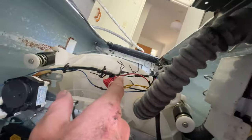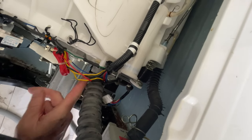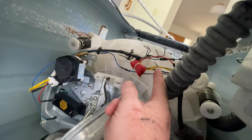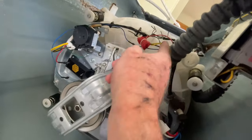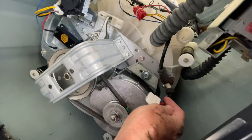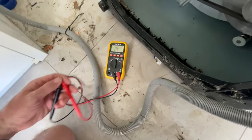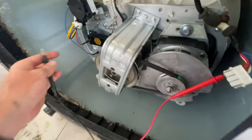A lot of the wiring — the green wire was actually very badly corroded inside. Before I joined it, I did have to clean the wiring. The red wasn't too bad. The blue wasn't broken up here — the blue was broken further down over here. The blue had a break in it. Now, to check the wiring, the easiest way — before you undo all the electrical tape — is just with a multimeter set to resistance. I like to set it so that we have an audible beep when we join the two together. I can put a probe in this side and touch it to the red wire on the other side — you know you've got a good connection with the red wire.